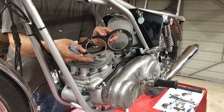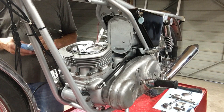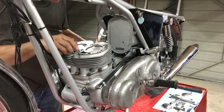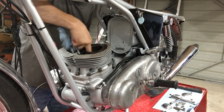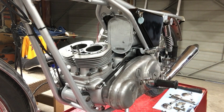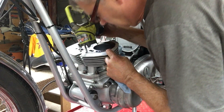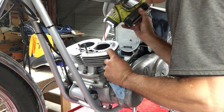With these type of gaskets, man, you've got to re-torque those heads pretty quickly. I couldn't believe how much they loosened off. This was the side that was smoking more, but I'm sure it's those rings. I tried to make them work, but they've got to be re-bored.